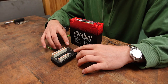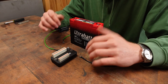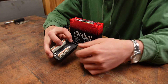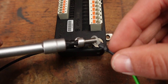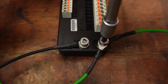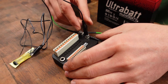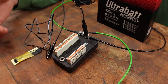The first step is to prepare the battery terminals, but we're not going to hook anything up to the battery until we're completely done and sure that it's safe to do. In preparation, we're going to use the M5 screw and connect the ground wire to the ground terminal on the M-Unit, then connect the wire to the positive terminal on the battery and the wire that goes to the lock to the battery terminal on the M-Unit. Now it's time to hook up the first basic light: connect the ground wire with a crocodile clamp to the ground terminal, then plug the other wire into the AUX 2 outlet.